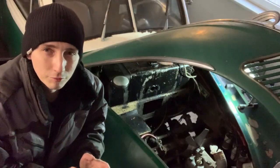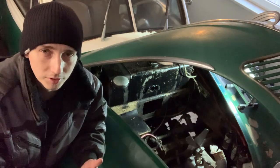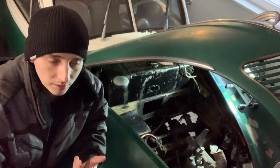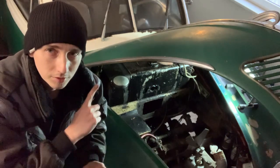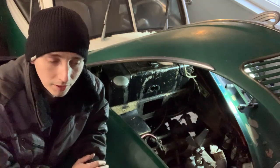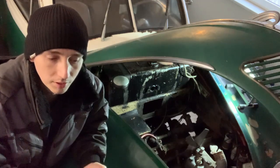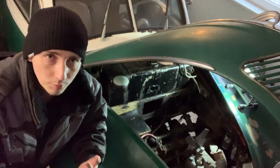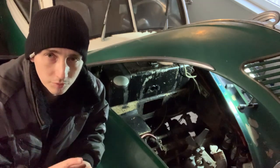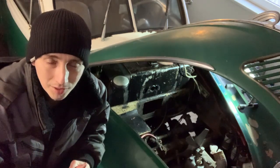In summary: we took the radiator out and refurbished it — it's ready to go back in but we're leaving it outside for now. We took the interior heater out and refurbished that — also ready to go back in. We also took the fuel tank out; it's back inside for now so it doesn't fly around in the workshop. The next step is to refurbish the fuel system — clean the fuel tank inside, make it pretty outside, the stopcock and fuel line. Then we'll also have enough space to reach the brake system, so the next step after fuel will be to refurbish the brakes.